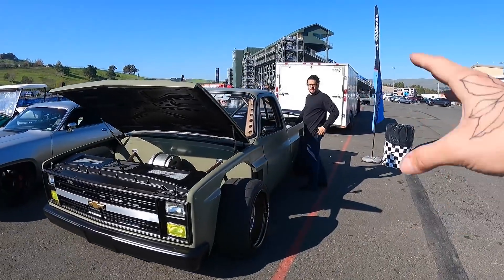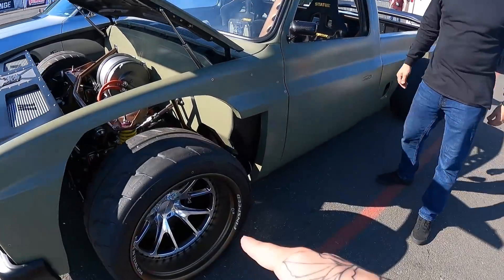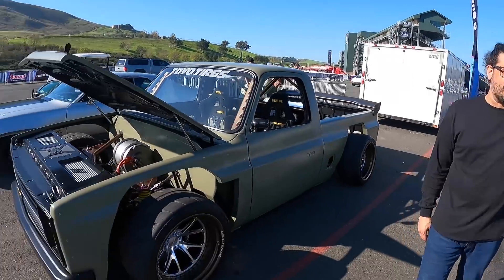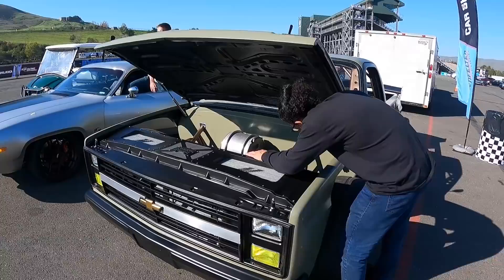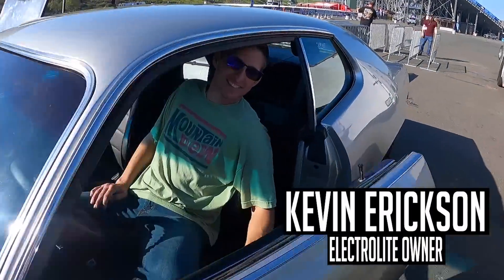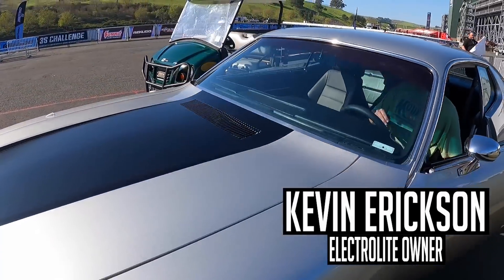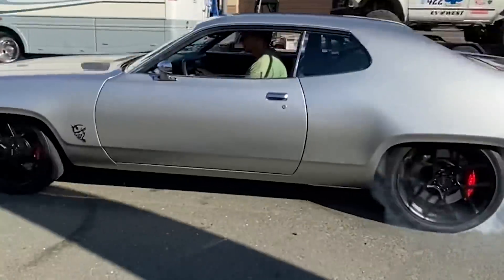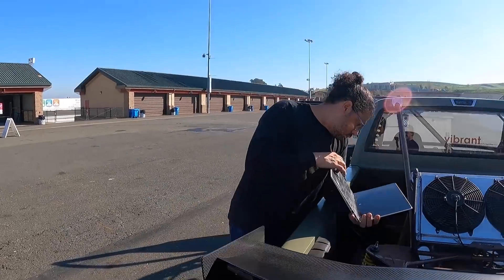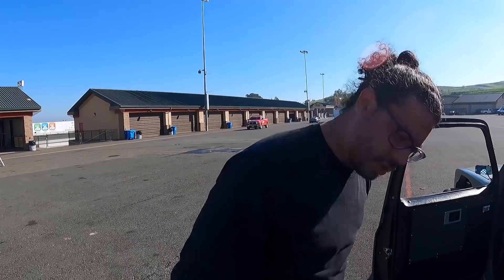Our truck is pretty much all set up for now. We got our fin speed wheels on. Andrew's going to do some tuning to the truck. We ran into our friend Kevin that you saw over at SEMA. He brought out his electrolyte. He's been ripping some burnouts for us — it is awesome. Right now I was just taking the brake regen off. Basically when you put it to zero throttle position it puts the truck into regen. I shut it off because anytime you pull off the throttle 100% it just wants to jerk you forward.